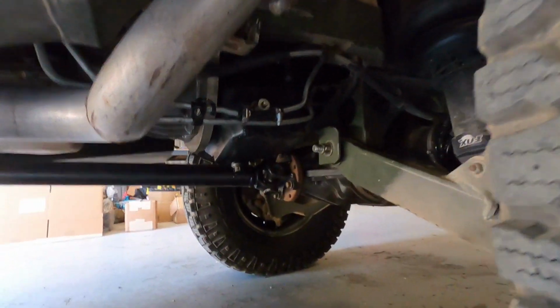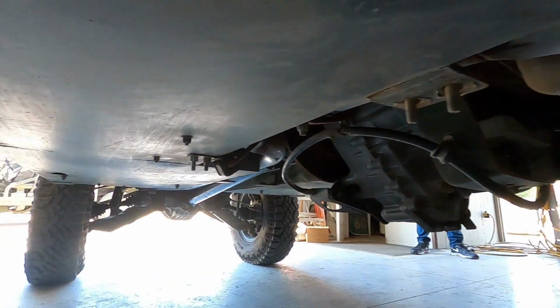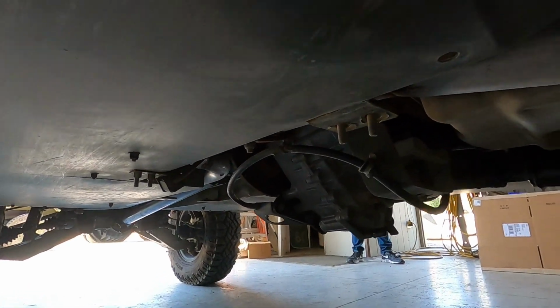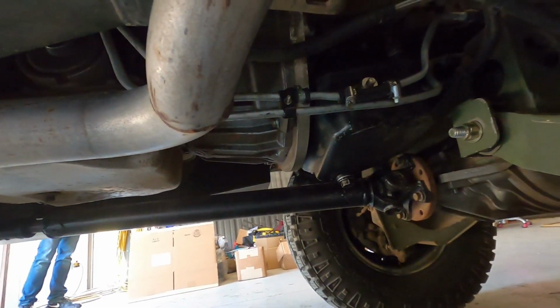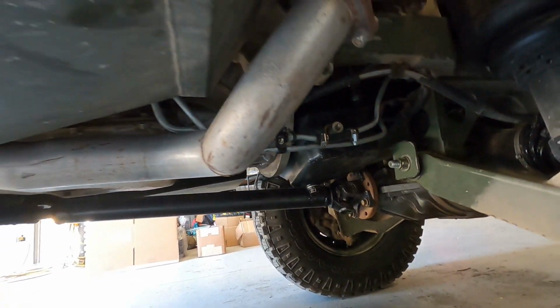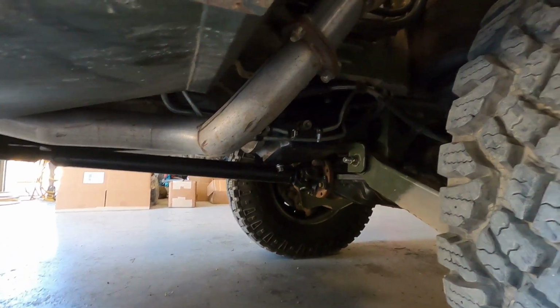Now we come down here to the bottom, and all 3 of the skid plates are missing. The original owner told me that the center one was the only one that came with it. I think it was the center one, and it was bent up so bad he couldn't even straighten it. Plus it had the aluminum ones, which are obviously going to be harder to straighten than the steel ones. Aluminum usually kind of work hardens and it'll just break when you try to rebend it.